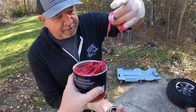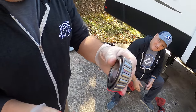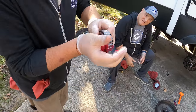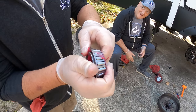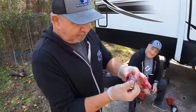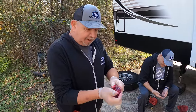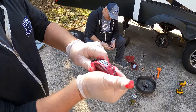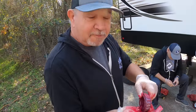Get you a little dab — just like your hair used to be — put it in the palm of your hand. Now we're going to take that bearing and on the back side we're going to start squishing it, like you're doing a spoon. Just keep on squishing it — you can't get too much; if anything you can get too little. I'm just squishing it in there. Make as big a mess as you can, just pretend like you're a kid again. For those of y'all that want the technical explanation: he's squishing it in until it comes out the top, then he'll roll the rollers around until they're completely coated — that way we make sure there's grease everywhere inside the bearing. Or as Phil said, just squish it around.